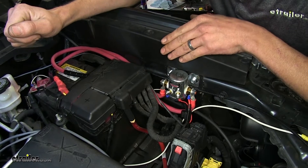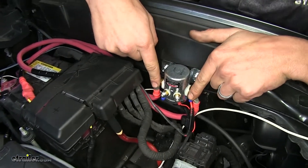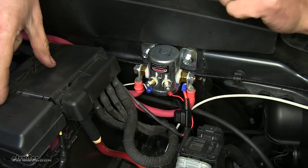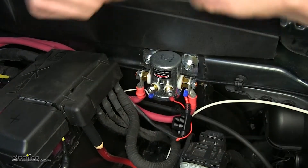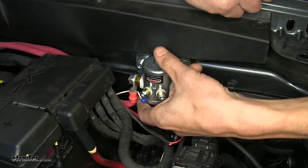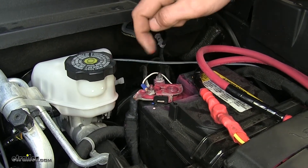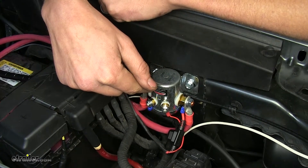Here's what it looks like underneath the hood. We have our solenoid here with our two battery cables — one connects directly to the vehicle's existing battery cable, and the other connects to the main fuse box, going in between to kill power to the vehicle. Two wires go inside the firewall through the gray duplex wiring and connect to our switch. There's also a white wire that we need to attach to a ground. We have a variety of options to mount our solenoid.